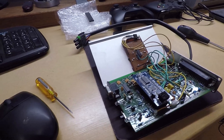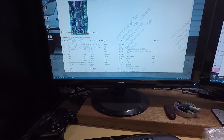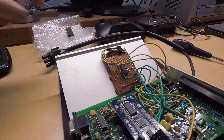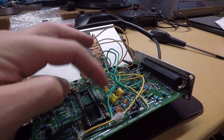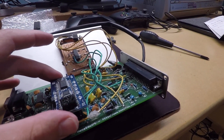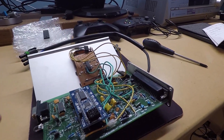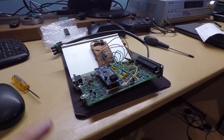After doing some googling and checking all the pins, all the pins on the MS-2 are actually the same as what the MS-1 chip has. So all the little circuits I have running off — launch control, boost control and all that — should all be the same. The circuit for controlling signal from the distributor or cam angle sensor should all work, and the circuitry for the individual coil packs should all work as well.